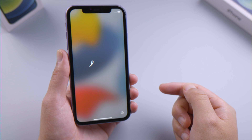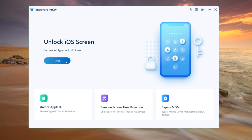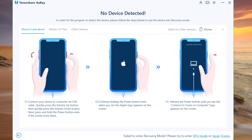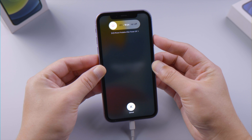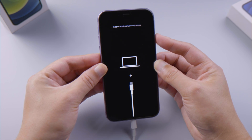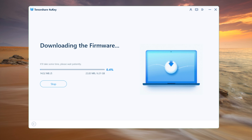This method is awesome, but if you don't see the erase iPhone button on the screen, or the button just doesn't respond to touch, you can still unlock it with 4uKey on a computer. To do this, plug your phone in. On the home screen of 4uKey, click on start, then click next. Now here's a step-by-step guide on how to enter recovery mode. For iPhone 11, press and quickly release the volume up and down buttons successively, then press and hold the side button, release it when you get to the recovery mode screen. 4uKey prepares the firmware for the device, and once downloaded, we can start to unlock.